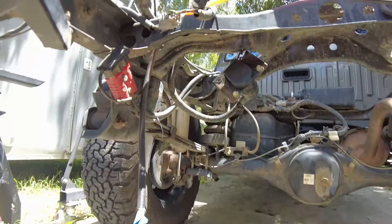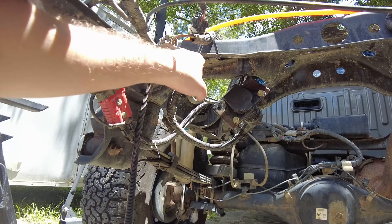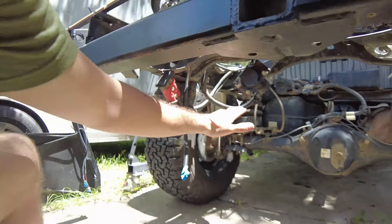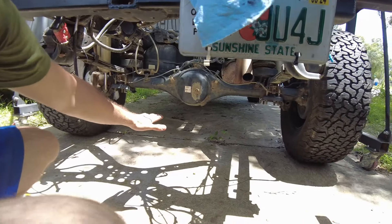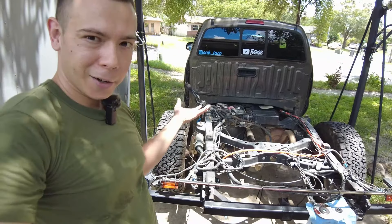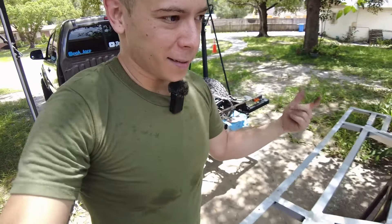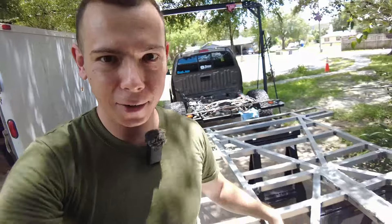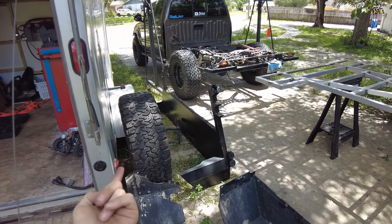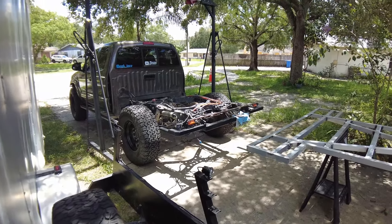This X is super cool but I need it out of the way because I'm going to mount a big 35 inch tire right here. The problem with mounting a 35 inch tire using the factory crossmember is the factory spare tire mounts at a lower or higher spot, but if you try to mount a 35 it ends up rubbing out here. Consequently that 35 inch tire sits very low. This is a very off-road oriented build so I need that tire tucked up as high as possible. That crossmember is doing four things - this new guy is going to be doing five things.